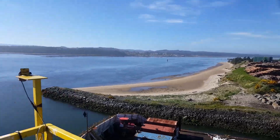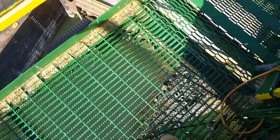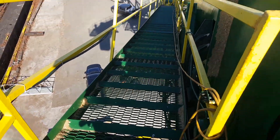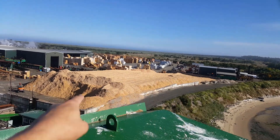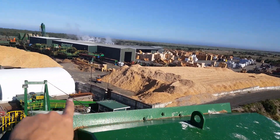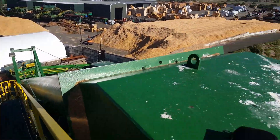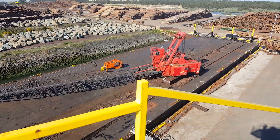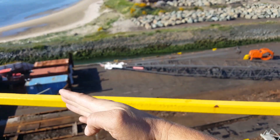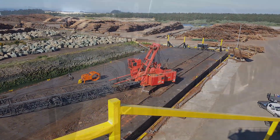More beach, and I am on top — there's the ground way, way below me. I'm on top of this chip chute. Basically they use the cat to push the chips into a trough, chains take it up to the bottom of this and then it conveys up this long tube out the snout below me to load barges. This thing's on wheels so it can roll out and fill chip barges. That's what I'm doing today.